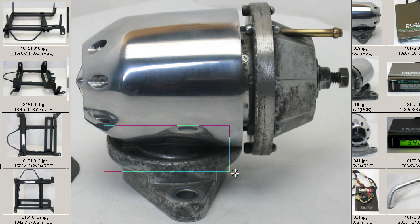It boosts pressure from below, combined with intake manifold vacuum that comes from this little nipple here — this connects to the intake manifold and pulls on the diaphragm. The diaphragm is resisted by a spring, whose strength is set by winding in this little bolt here and holding it in place with a locking nut.